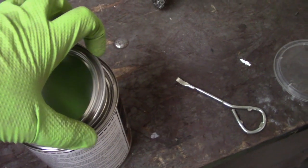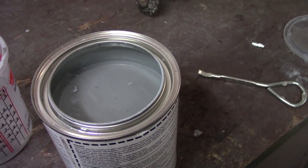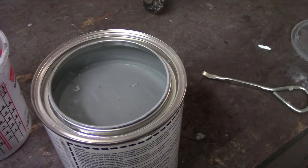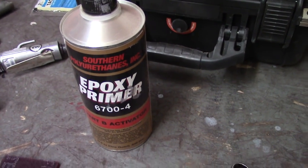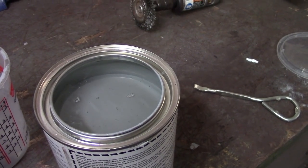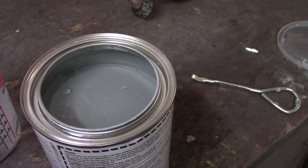This is the epoxy primer — it's kind of hard to see, but it's got a false top there. This is why it's very important to mix your paint: it's been sitting since I bought it and you can see how it's completely separated. Part A here — Part B, the activator, is just a liquid that doesn't really separate — but you can really see the separation. This is completely brand-new, just opened it. You can see that haze at the top — that's all chemical up in there.